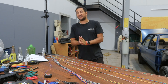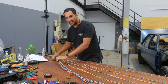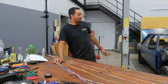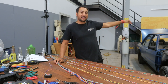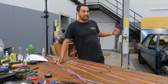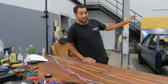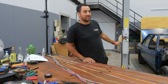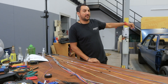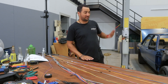I've separated the bulk of our harness into the different areas of the car that they're actually going to go. This big bunch here is our main bunch which is going to go through the firewall grommet once I've done a little bit more work. We're most likely going to put it through somewhere near the trans tunnel on this particular car. A very common place for the loom to go through is the firewall on either the left or right-hand side. Because we've got lots of room in this engine bay and it's all been nicely painted at the back, we're going to keep it away from the dump pipe, away from the driver's feet, and put it through the trans tunnel — there's just so much room there and it's all out of the way from heat, fuel lines, and everything else.